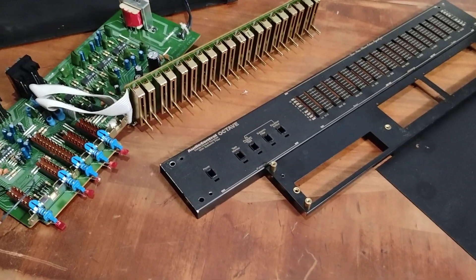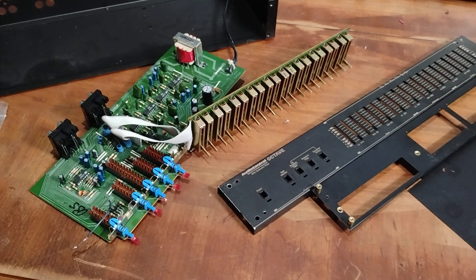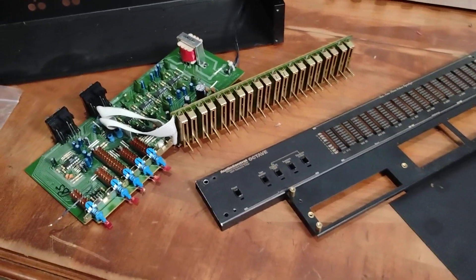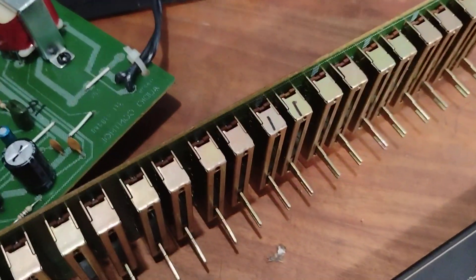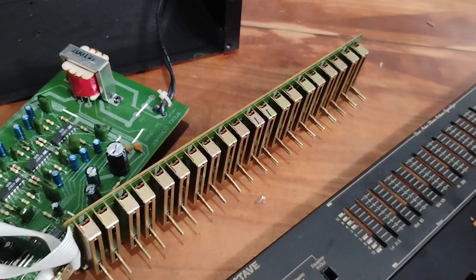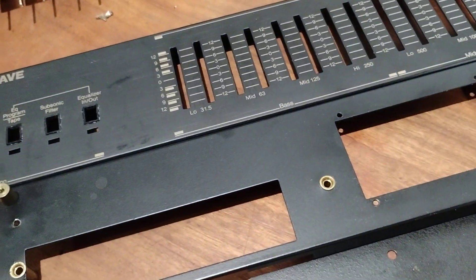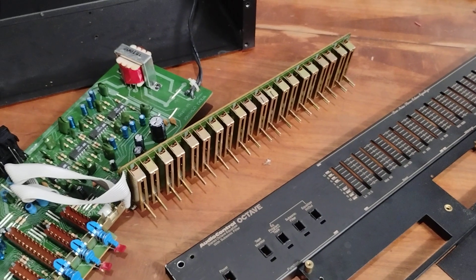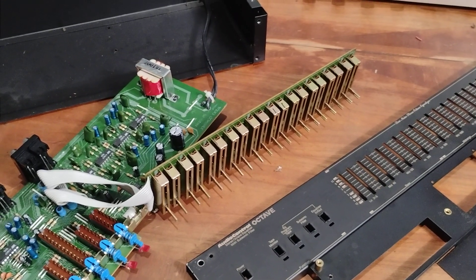I didn't even know they made home audio, but I ran across this on an auction and picked it up for $30 or $35. When I hooked it up it was working but had a couple issues. One was the channel right there with the black marks on it. The right channel, when I would turn up that octave — the 1000 hertz — would turn up all sound: highs, lows, everything. So I knew there was something wrong with the crossover.